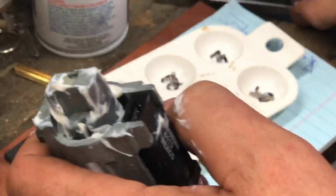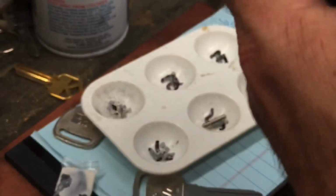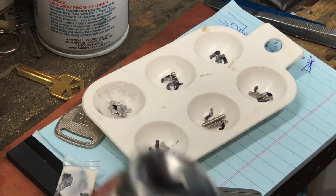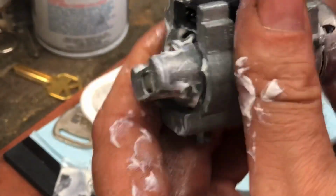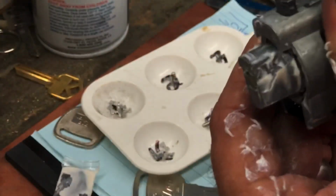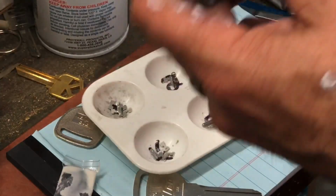in the hole right there, so that as that turns, it'll coat the inside, and you can ease it down in there as well with a sharp pointed object. So all that goo is there for a reason, besides getting over everything. And there we go, you're done. Check it, make sure the key comes out, make sure it doesn't catch, make sure it's smooth, all of the above in this case. So you're good to go. That is how you key up a GM10 cut in dash, or any other one for that matter. Like I said, they may look different, but they all key up almost identical.